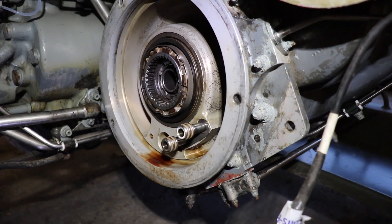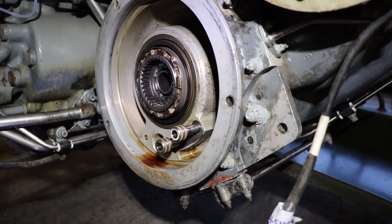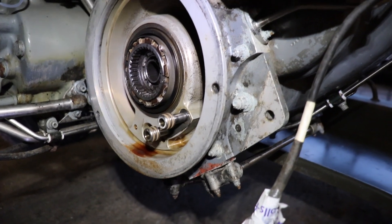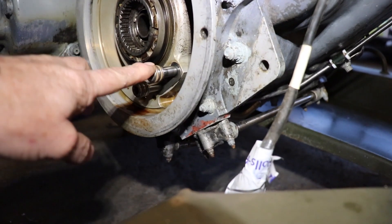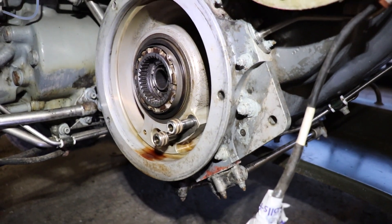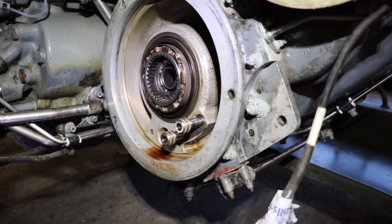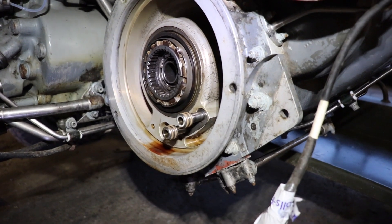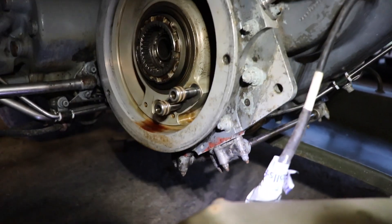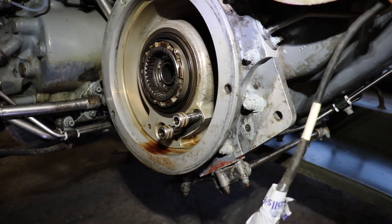Normally we would blank this off with a flat piece of aluminium disc, put the V-band clamp around it — probably a gasket or something — and usually not a problem. However, these two things here are sticking proud, so we've got the option of making a fancy cover to include those, or whether we just dispense with them altogether. I'm quite tempted just to dispense with them because they're not actually required — we're not going to be putting an IDG on this engine.